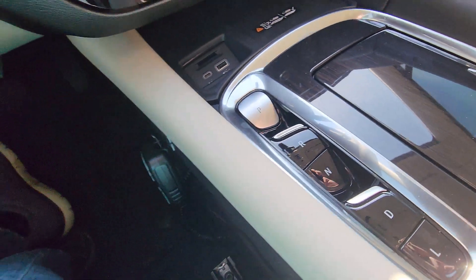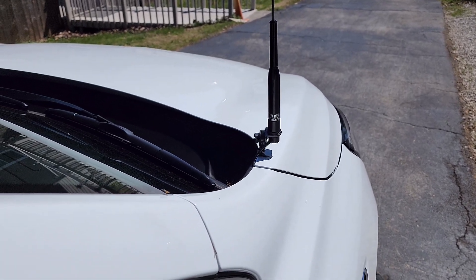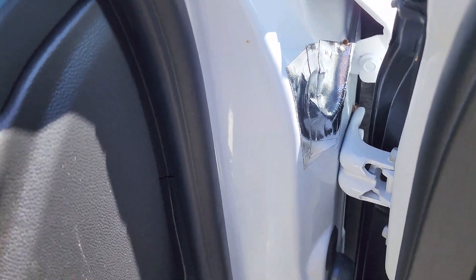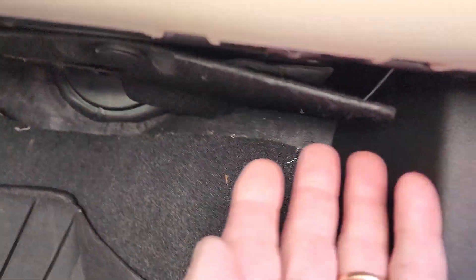The antenna is on the hood. I got it all set up and brought it into the A-pillar. There's a little loop right here to keep the water from rolling back into the A-pillar — you've got to make sure you do that because the water will run in. You bring it into the A-pillar, get up underneath, pull the wire down, and then run it across the top and around. Let me pull the seat back here.